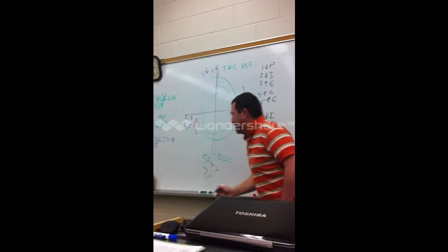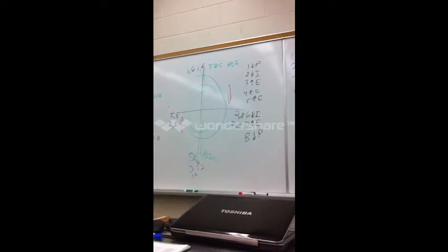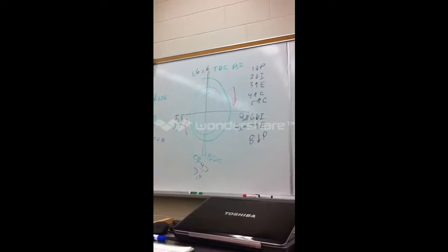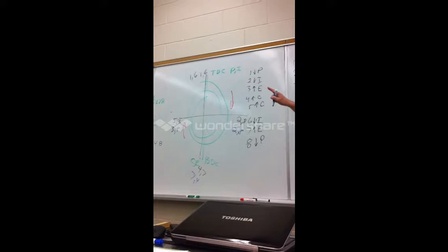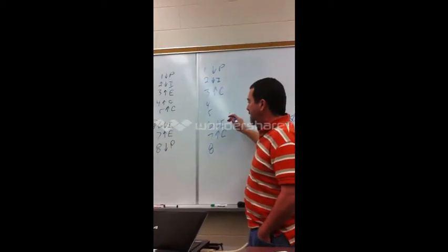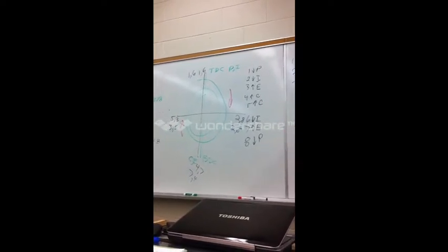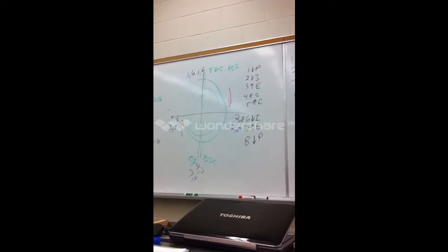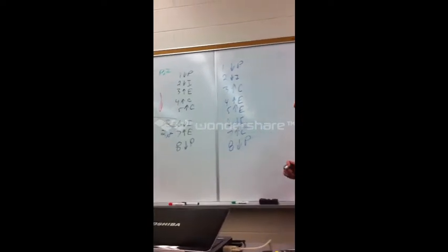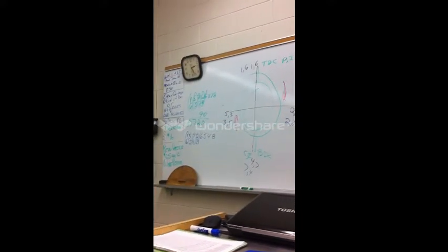Next is three. Is three going up or coming down? Up, on compression. Next? Seven. Up or down? On compression. Next? Two. Up or down? Down, on intake. Next? We already got it. How'd we know? Mating cylinders. Okay, halfway through, we're on the right track. Next? Five. Up or down? Up, on exhaust. Next? Four. Up, on exhaust again. And lastly? Eight. Down, on power.